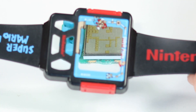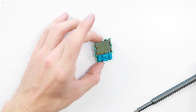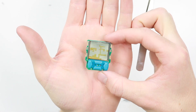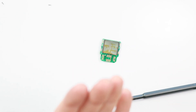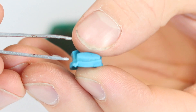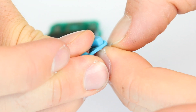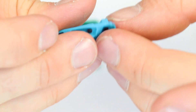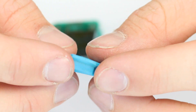So I can give this a nice clean which is going to be very, very satisfying, although this thing isn't really in bad condition at all. And here is our little Game and Watch — this is all of the components to make this thing work. So here we can get access to our little button piece. Taking a look around, we can actually probably see why this thing isn't working — if I just show you this, it's sort of all crunched up on the side. I've worked it out a little bit and that's looking a bit better. I'm confident now that it will probably actually work.